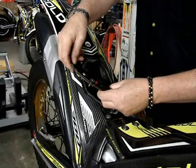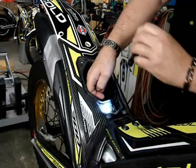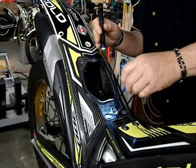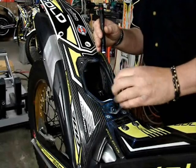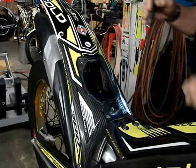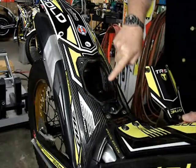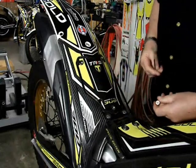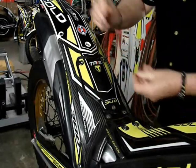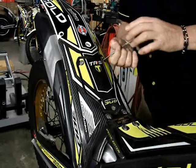Then just put the flap back in again — don't lose that little screw. I use my little pen light so I can see what I'm doing. You set it right back down in there, and it goes together really nicely — this was a single take and it fell right into place. Access is through that screw hole from the front. Check the gasket to make sure you didn't disturb it when working on the filter, then put your three screws in lightly and tighten them in a cross pattern.